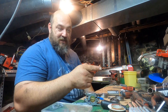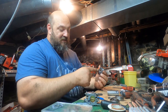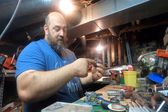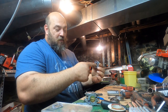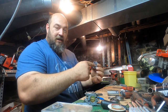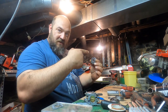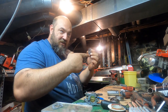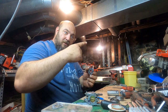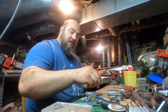You can even have such a vibration that if the crankshaft has enough play in it, it could potentially go to one side, and as it rotates around, open up an air leak around that seal, because it won't be centered anymore. It'll be off-centered. So as it rotates around, it could potentially give you an air leak. You know what I mean? Because it's off-centered.